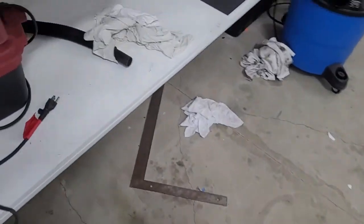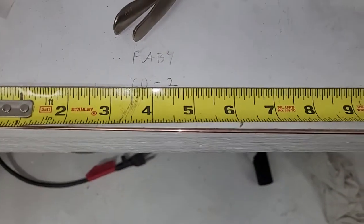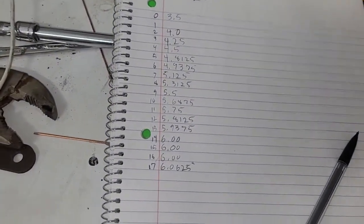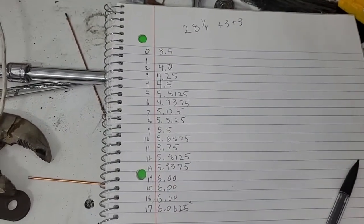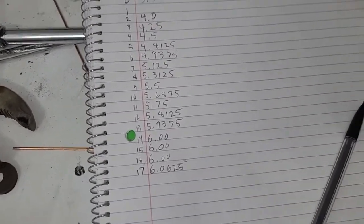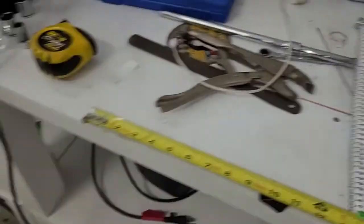It's pretty straightforward. I have a ruler here and I take this piece, bump it against here — most of my marks were around six inches, so right here at six there'd be a little sharpie mark and I can read that number off. Then I just come over here and write it down. I did zero through 17 — I need to go back and do number one because my clamp was blocking it — but once I do that, I literally have the dimensions of the entire curve of the bumper from that reference.